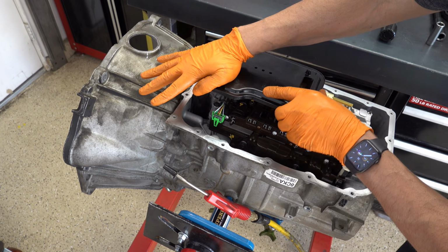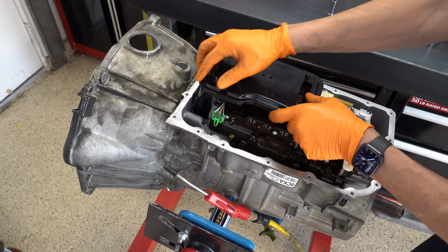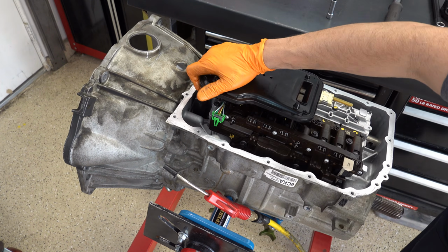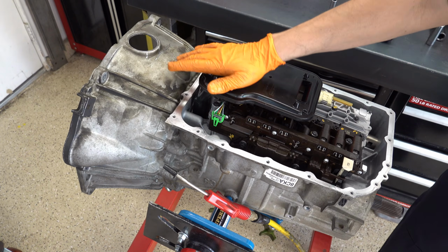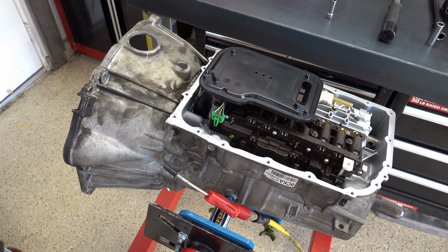So Sonnax or Transgo, it really doesn't matter. Whichever one you prefer. I prefer Sonnax, but Transgo is also fine too. You can buy the whole Transgo reprogramming kit. That'll come with the clutch select valves, or you can buy the basic shift kit, buy the clutch select valve kit separately, and the kit for the pump, the PR valve and such separately. In Sonnax, same deal.